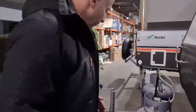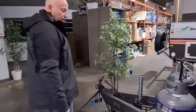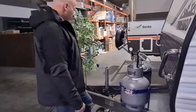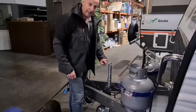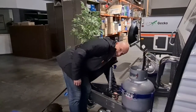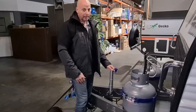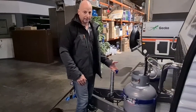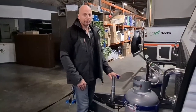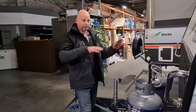There's a compliance plate for the chassis — it's an F&P chassis, made here in Melbourne. The jockey wheel is fairly self-explanatory: it winds one way to go down and the other way to go up. It comes off by undoing this screw handle here. Make sure the jockey wheel is taken right off when travelling — it's not okay to just lift it up; it actually needs to be completely removed. The jockey wheel is also used for levelling the caravan front to back.